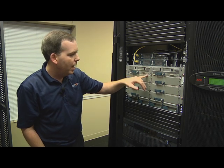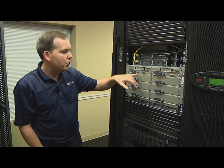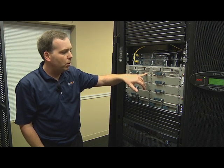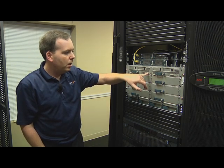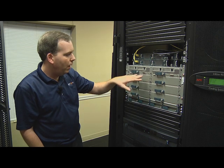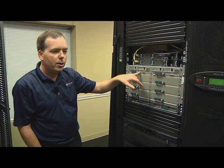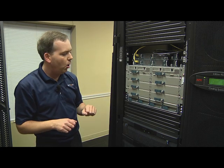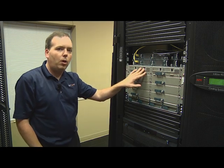And then we've got lights, we've got your alarm lights, your warning lights, network connectivity, the hardware reset button if you want to physically reset the blade, power, and there's a locator ID on the front here too that we can activate via UCSM and figure out which blade we're actually talking about. So that's how you install all of your blades.